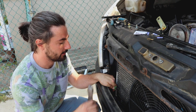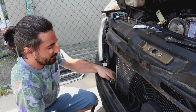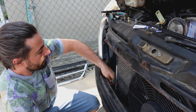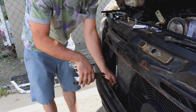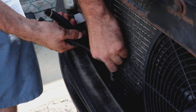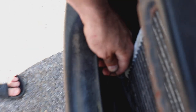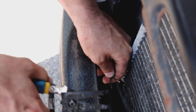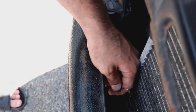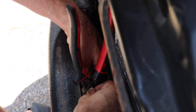What I'm doing right now is removing this piece that used to connect to the horn — it's a plug-in connection. On this new horn we don't have that, so I have to replace it by cutting this out, putting the actual wiring on here, and then putting it into the new horn. You want to cut as close as humanly possible to the piece. It's as simple as cutting right across here — boom boom. There's your two wires. Now we gotta strip those two wires. We're gonna take this tool right here and strip each one. We'll clamp it on there.